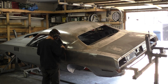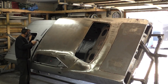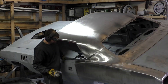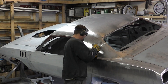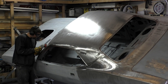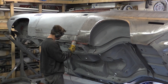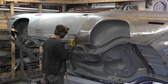So we're going to go through with a surface prep disc and just finalizing everything and touching everything up. I am using a yellow surface prep disc. You could use the red ones too — I think for this the yellow one's fine. Also where we're going to put the lead, I'm running through it with a stiff wire brush on an angle grinder. I want to get every bit of paint material or anything else that could be an impurity out of that seam, and I think the only way to do it properly is really dig the wire brush at high RPM in those areas.